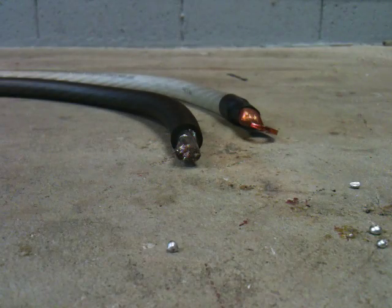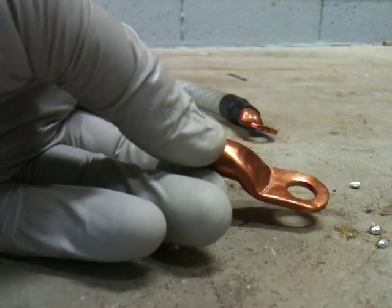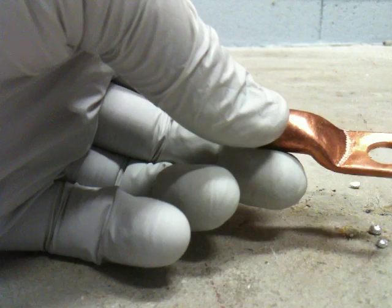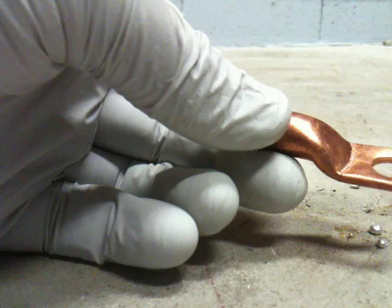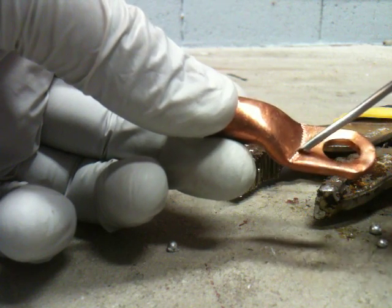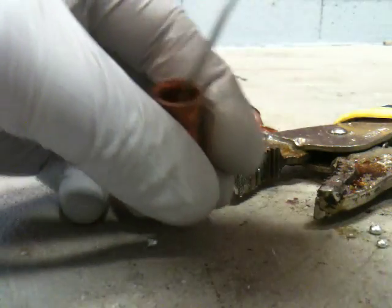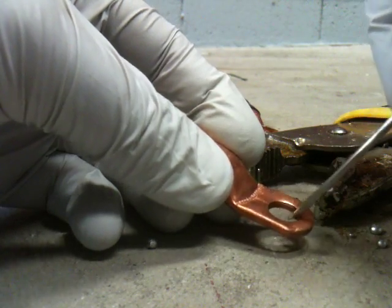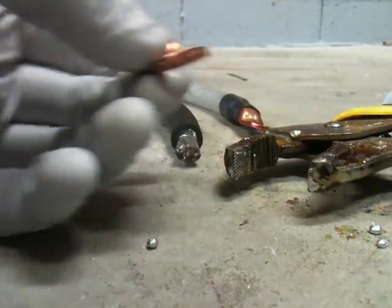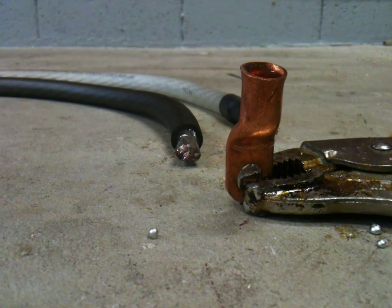So the other way you can do it is you can solder them. This is something I just started doing — actually Johnny gave me a cool little tip. This is just a Car Quest crimp, they're like a couple bucks a piece, and they're actually not crimped very well at the end. So you want to take a pair of vise grips and just crimp them all along the seam here to seal them, because when you put the solder in and shove the wire into the terminal, it creates quite a lot of pressure and the solder tends to bleed out. I've crimped this to kind of speed up the video, and I'm using rosin core 40-60 solder — this stuff's real thick.